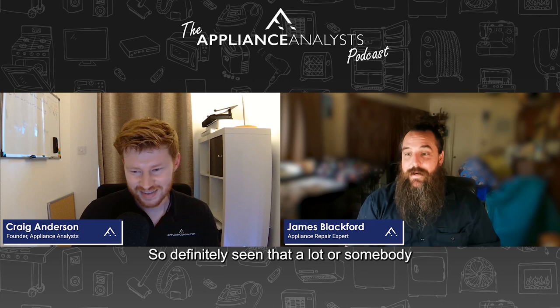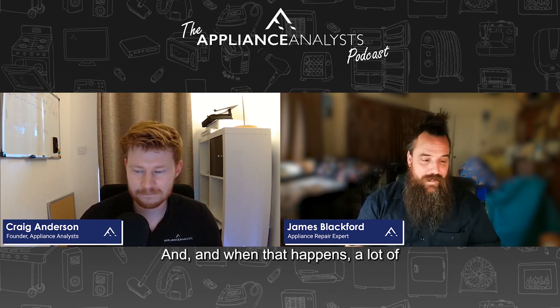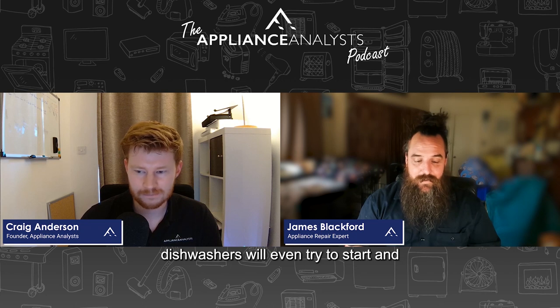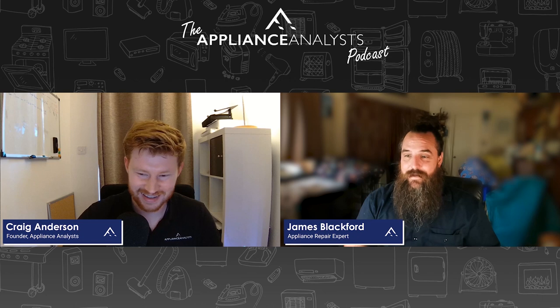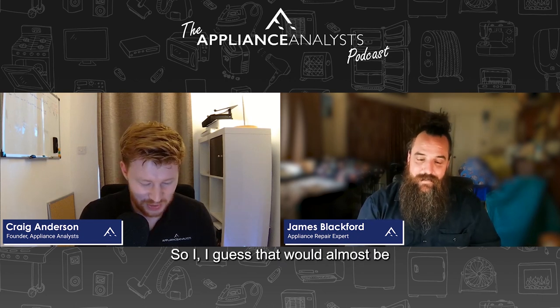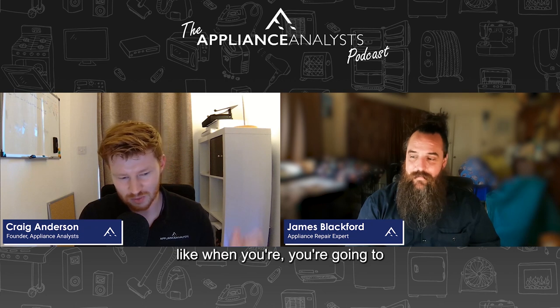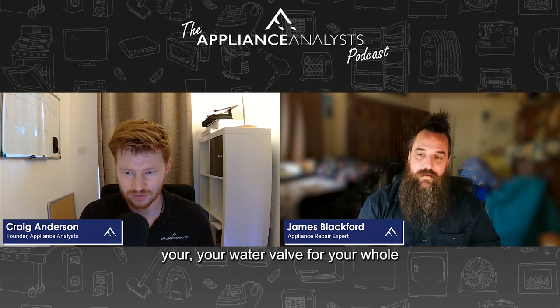Yeah, definitely seeing that a lot, or somebody gets under there to do something. And when that happens, a lot of dishwashers will even try to start and run and there's just no water in there. So that's one very confused dishwasher. Oh yeah, definitely. So I guess that would be like when you double check your circuit breaker, it could also be worth double checking the water valve for your whole house.